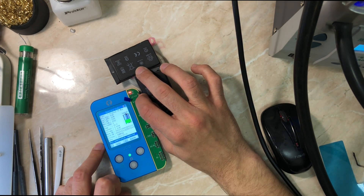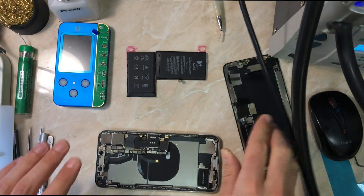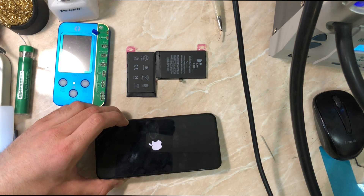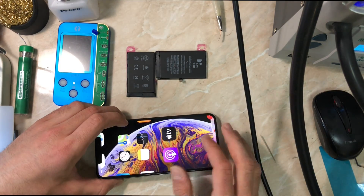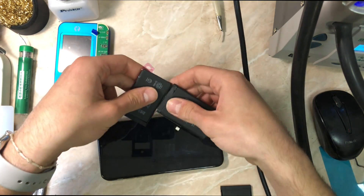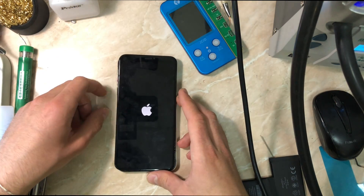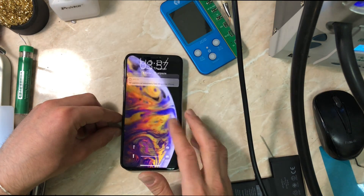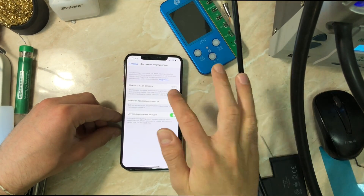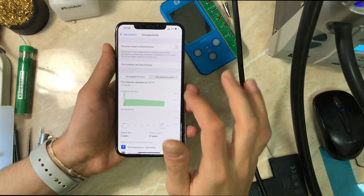Resetting the health now — I prefer not to use the cycle-clear button because it can sometimes be glitchy. Everything looks good: 100% battery health and zero cycle counts. The final step is to reset the battery connection using an iOS bug to get the battery working with no important battery message. Note: if you skip this last step, it could cause an error in battery settings, though the battery percentage will still display. You can trigger this using a non-genuine battery or another iPhone X battery connected to the phone until the important battery message appears, or use your power supply.